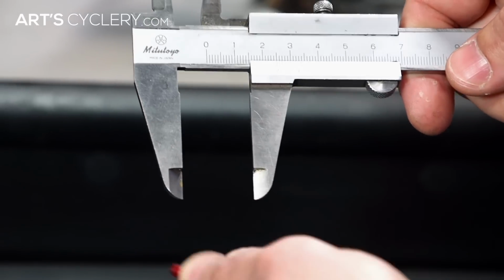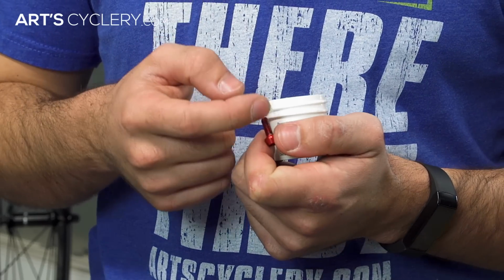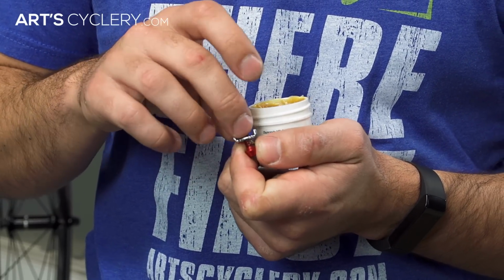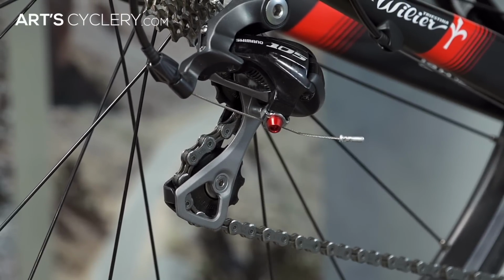Swapping the bolts is pretty simple. Just measure the old bolt and then select a bolt of the same length or as close as possible. If you have to use a bolt a little longer than the one you removed, make sure that the threads aren't going to bottom out before the bolt gets tight. Prep the threads by applying the anti-seize compound or appropriate treatment, apply any necessary washers, and install the bolt. After the bolt is torqued correctly, you're done.